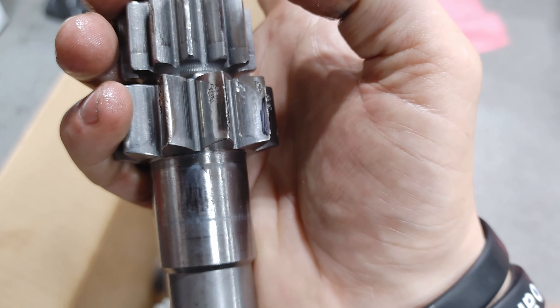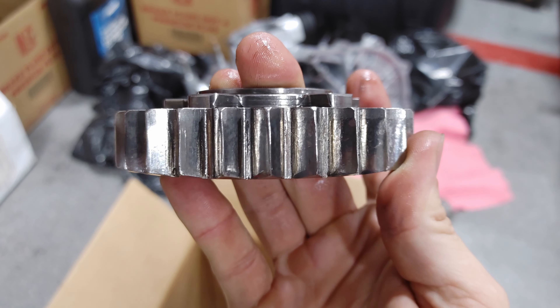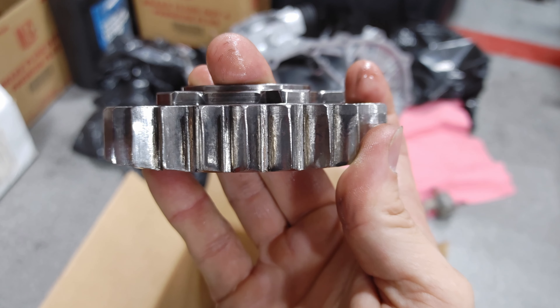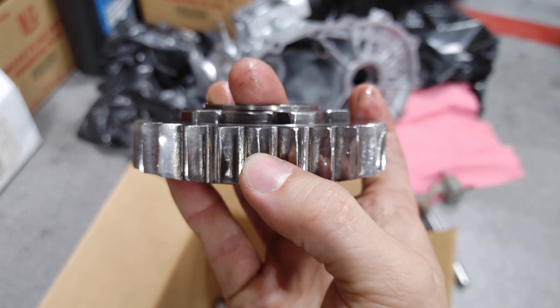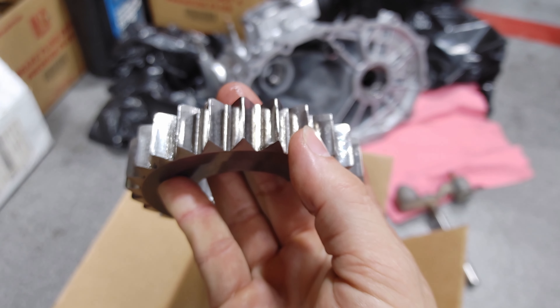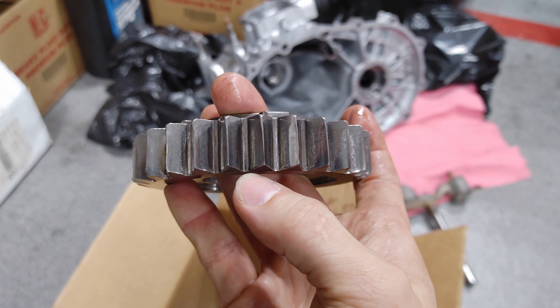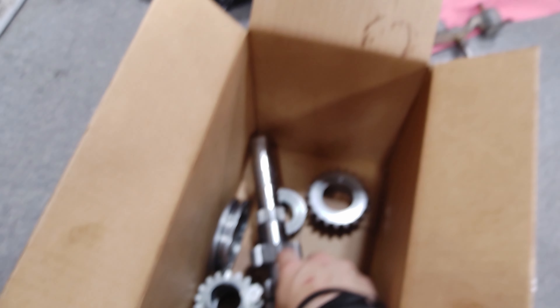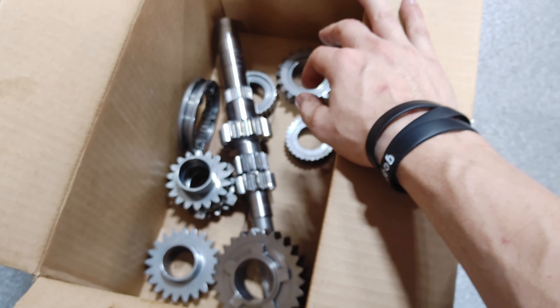So I got on the horn with them like, hey, need some more parts. I took a look at first gear on the counter shaft and if you look really close you can see that the gear actually has a little wave to it — right in here is pushed over this direction. I wasn't about to put a new input shaft on this old first gear. So we were waiting on a new input shaft and first gear and the correct 3-4 hub — probably for the past three months.